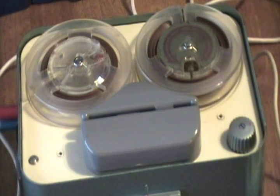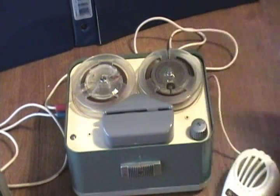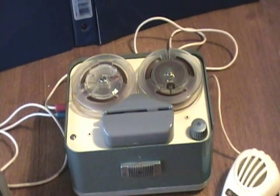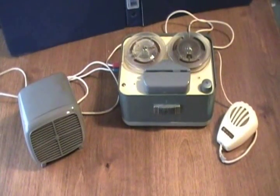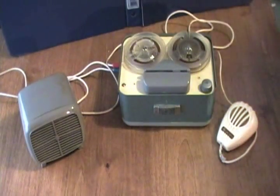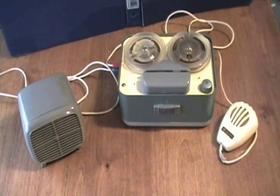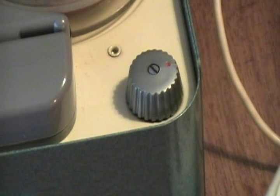Probably because the design of this machine is incredibly simple — there are no belts at all, it's all idlers. It's a very simple mechanism, but it's not easy to get inside to show it exactly. The machine is working off original parts. The only problem I'm having with it is it tends to record and play at slightly different speeds, so I'll record something and when I go to play it back it plays back a little bit slow. I have to turn this knob very slightly to get it to play back at the right speed, because right here is a speed control knob — which is just a rheostat — and that's all that controls motor speed. There's no governor and no servo control, just a rheostat.